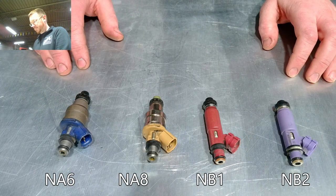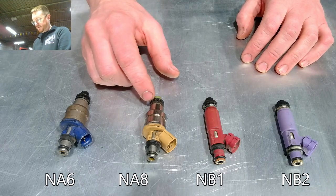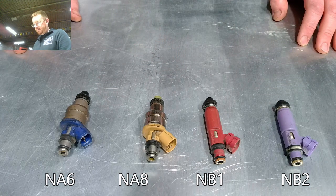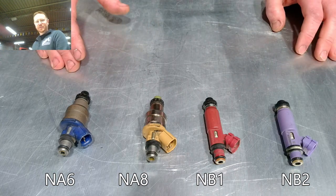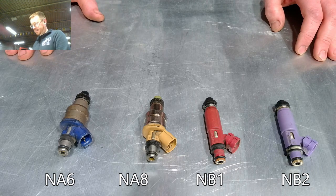Most of the problems come when it's not quite aligned right — you get the bolt lined up and start torquing it down, and it'll just start to crush either the spacer, the tip, or cut the o-ring. In any of those cases, you're going to have a lot of problems. That's everything on fuel injectors today: mostly about identification, specifications, and some of the issues we've seen and our best practices. If you have any questions, please leave them in the comments, and if you have suggestions for future videos, we're always happy to take ideas for new content. Thanks for watching.